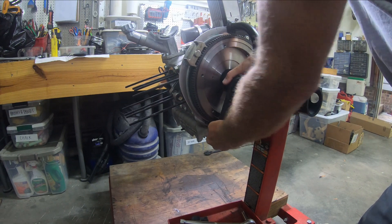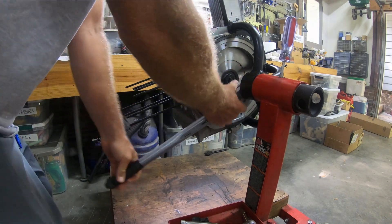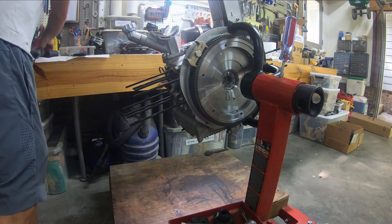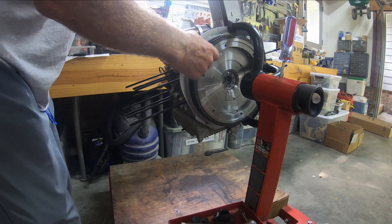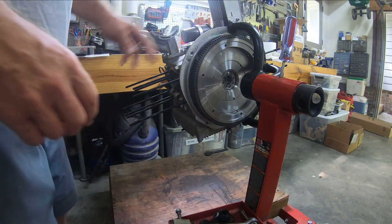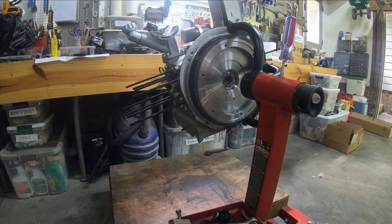What had happened was I had used the main seal once and then put it back on again, and I didn't put any oil on the shims. There we go — I got that thing off. That is fabulous; I would never have been able to do it without the torque multiplier. So what I'm going to do now is take off the flywheel — the end play is perfect — but I'm going to redo the main seal and oil up the shims really well.